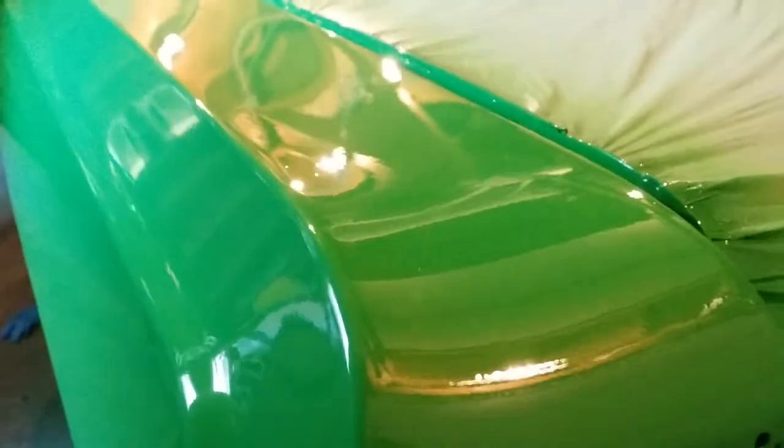Basically it's a base coat clear — it's clear but it's a base coat with my pearl in it. If you get the right angle you can see it — that's the gold pearl in the paint. So that's four coats of base total, two mid coats with the gold pearl, and three coats of clear that I put on wet. I just got done with the third coat.